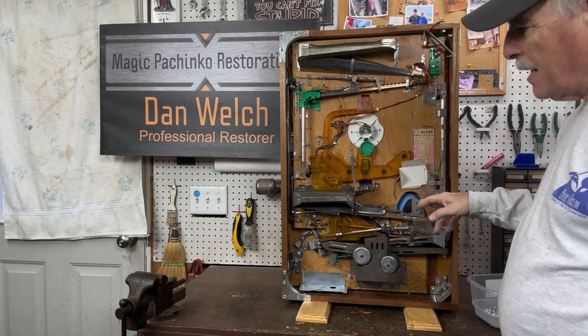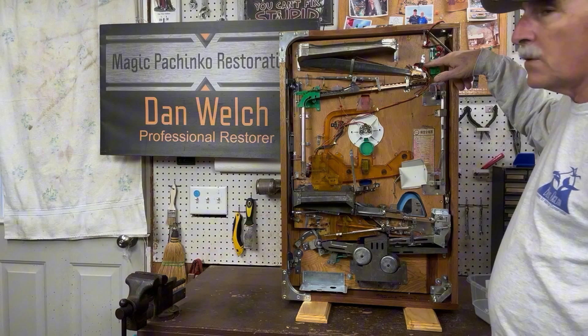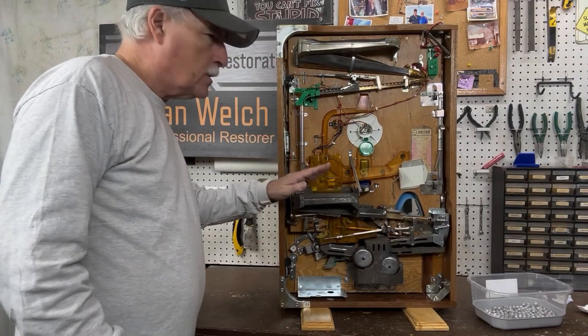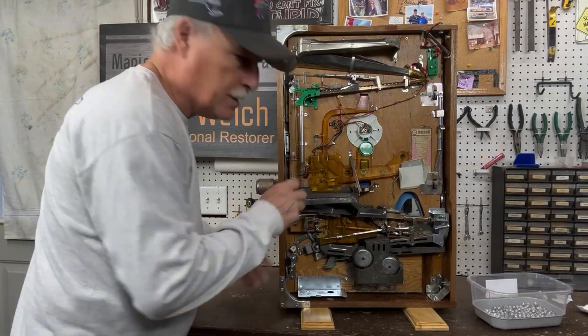Now this is full, this is full, the turnaround is full — it's full all the way over to here, and it's ready to drop more balls when necessary. It's full down to the jackpot, and it's ready to pay out the amount of balls that are supposed to be in the machine. And if you notice, the ball-out light is off. The other thing you want to make sure of — and this one's a little bit hard to see — is the seesaw. It's right in this area; let me bring the camera in so you can see it. It's brass, made out of brass.